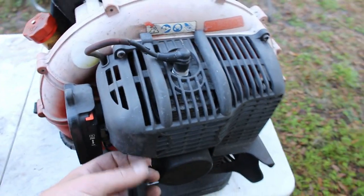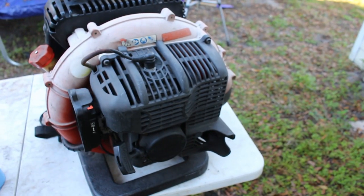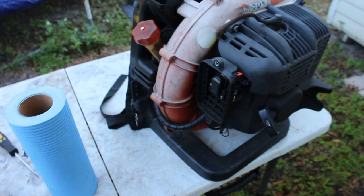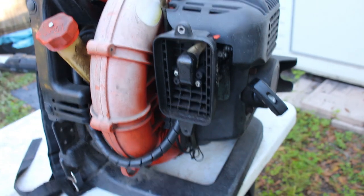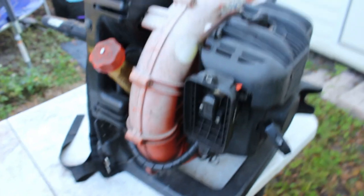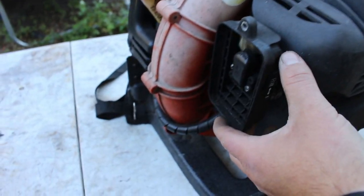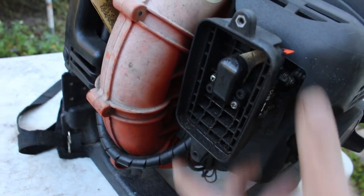It's not locked up — it rolls over, kind of hard to do with one hand. I want to get some oil down into the cylinder because that's a long time sitting with no lubrication. It does feel like it has compression though, which is good. We're also missing an air filter cover and air filter. If we do get it running the fuel mixture won't be exactly right, but the choke here is functional — nothing's broken, just a little dirty.